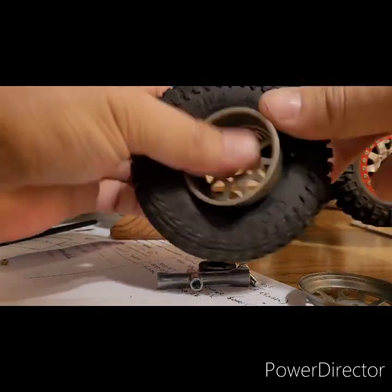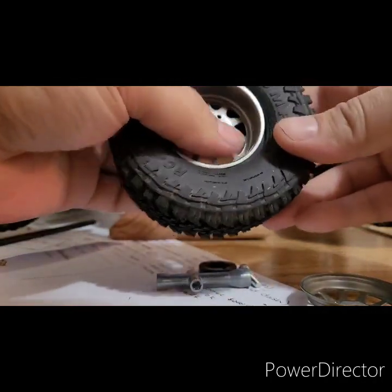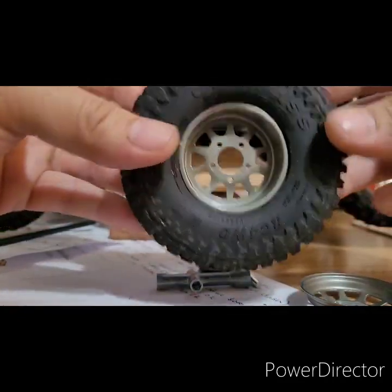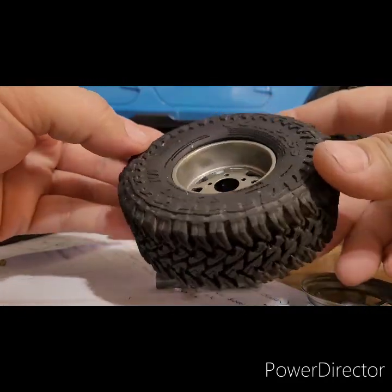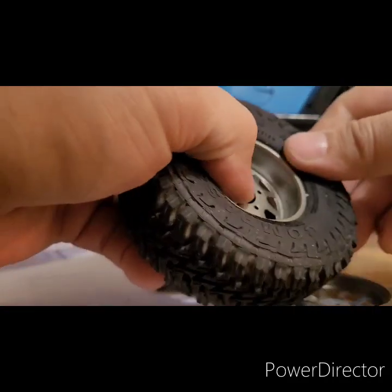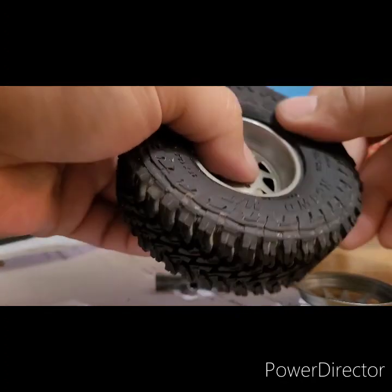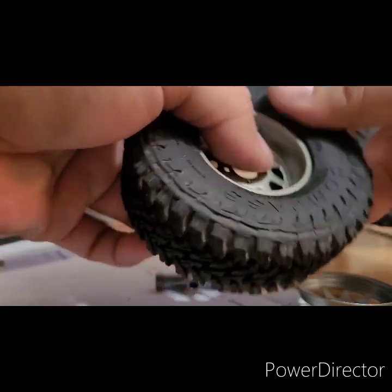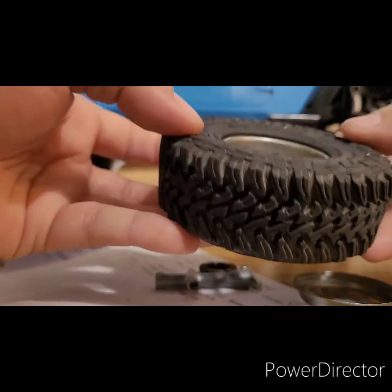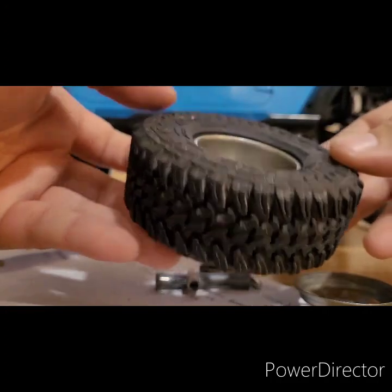Now on this, you start with the back piece. I kind of wedge one in, and then as I pull out and around, it will eventually just pop into place. And even after it pops into place, I really like to make sure I go all the way around it to make sure it's nice and evenly seated. This is really important. If it's not, it's going to pop out later. Even if I have to redo it, I'll do it again to make sure that this step is done perfectly. Checking that bead one more time, making sure everything's perfect.